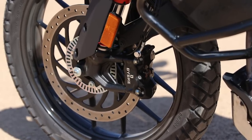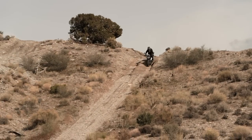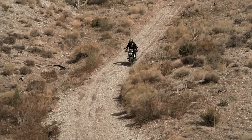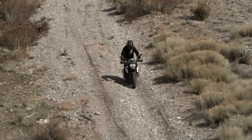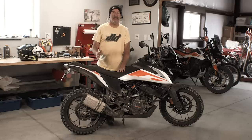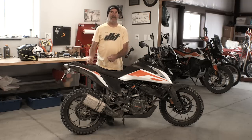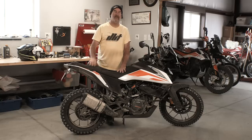The front brake on this bike is insanely strong, so we're very happy it has ABS. It has not only regular on-road ABS — keeping front and rear wheel from locking — but you can set it in off-road ABS mode, and the setting will stay, which we love. That means you can lock the rear wheel while the front still has ABS braking control. You can't turn the front ABS off entirely. We actually found a way to do it by disconnecting the rear wheel sensor, and the computer doesn't like that — but that way we can disable ABS and traction control, which so far hasn't caused too many faults other than a flashing red zone on the dashboard.